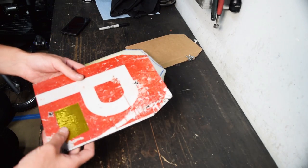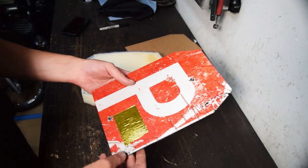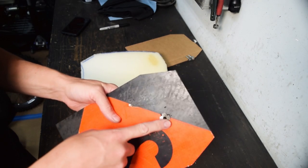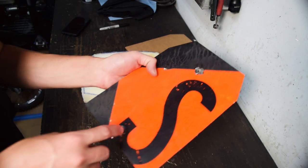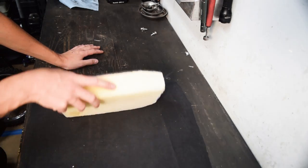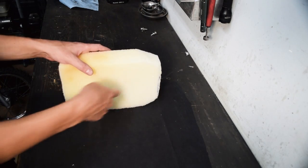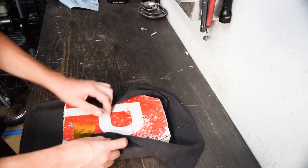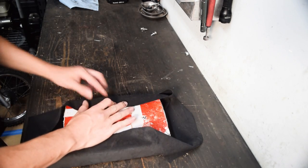That was a bit sketchy but it's done, and luckily the safety flip-flops came in clutch. Seat pan is now made — it's all trimmed up, ready to go. Got some foil tape on the area where the exhaust is kind of close. The T-nuts are pressed in — normally these get hammered into wood, but as it turns out they don't like being hammered into ABS plastic, so I actually just heated them up and pressed them in so they melted themselves a hole to sit in. Some glue on the foam, line up the Alcantara so that it will moderately stay in place, then staple around the perimeter just as a placeholder, and then I'm going to actually glue down the material around the outside.